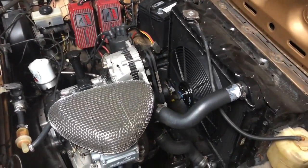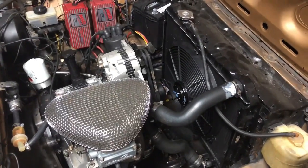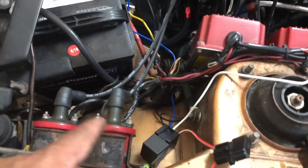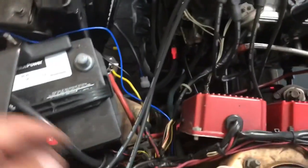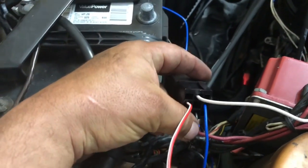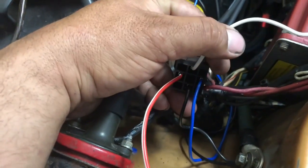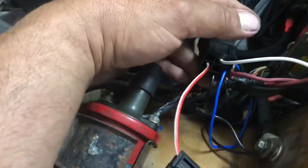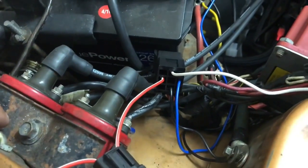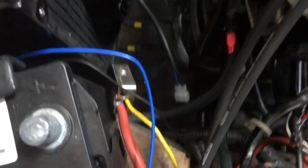Can't get enough of it. Now for the next step — wiring it in to get it working. Over on the other side of the car with the relay — it didn't come with instructions, but looking at it and looking at a normal relay: the black wire is the ground, it tees off and I put it to a bolt here. This wire is the one that will turn on the relay, and this is the fuse power that goes into the relay and out from the relay to the fan.